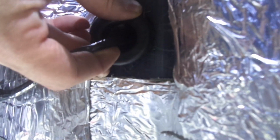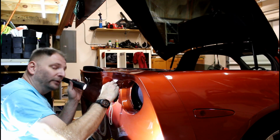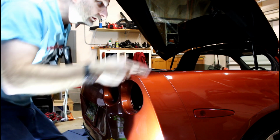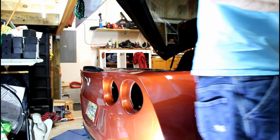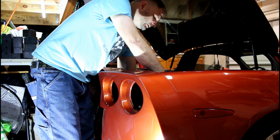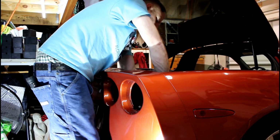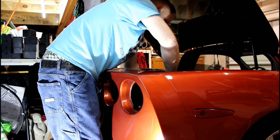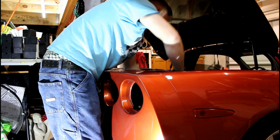It goes just like that into that hole. That's where the hole is, and the grommet goes inside the tail light. You ain't got to drill squat. You just got to poke a hole in that rubber, just like we did with the grommet on the power cable. Take a metal device. You're going to want to start making small holes. Again, do not poke yourself. Do not poke through your wire harness. All right.